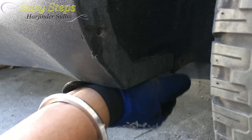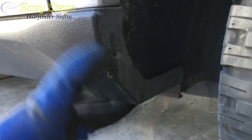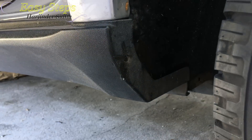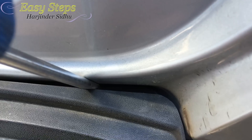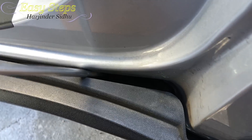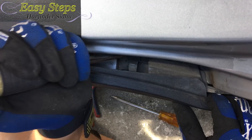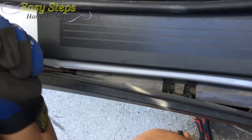Make sure the plastic bumper is free, open your door, and then pull it a little bit forward. There are going to be clips right inside here — when you make the gap, push down on them with the screwdriver and the plastic will pop off. Right here, these big clips — just push it down and the clips pop out.